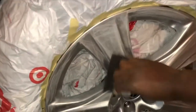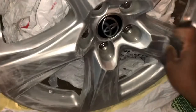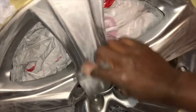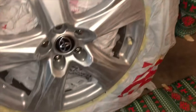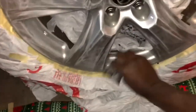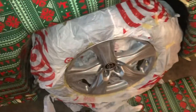This is the sanding process — just getting every area, sanding it down. As you can see, it's going from smooth to a little rough, depending on the damage to your rim prior to painting. You might need a rougher sandpaper, but my rims are fairly new so not much sanding is required. The only sanding necessary is to ensure that the paint and primer sticks. This is a pretty good rim — no scratches, no dents, fairly new.